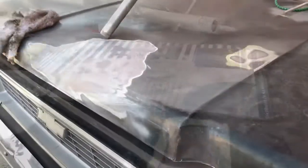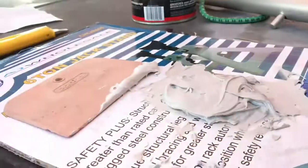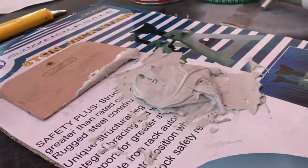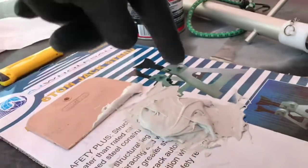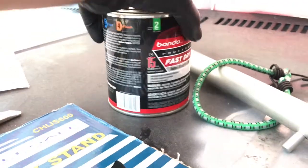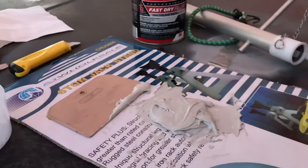All right, that's the plan. Surface is clean, prepped. My Bondo here, let's say about a half inch high. Let me take a strip of the hardener. That's it. And then you mix it side to side, not stirring. You don't want air. And I went with Bondo brand, actually. It's actually a 3M company now. See that? 3M's good stuff.